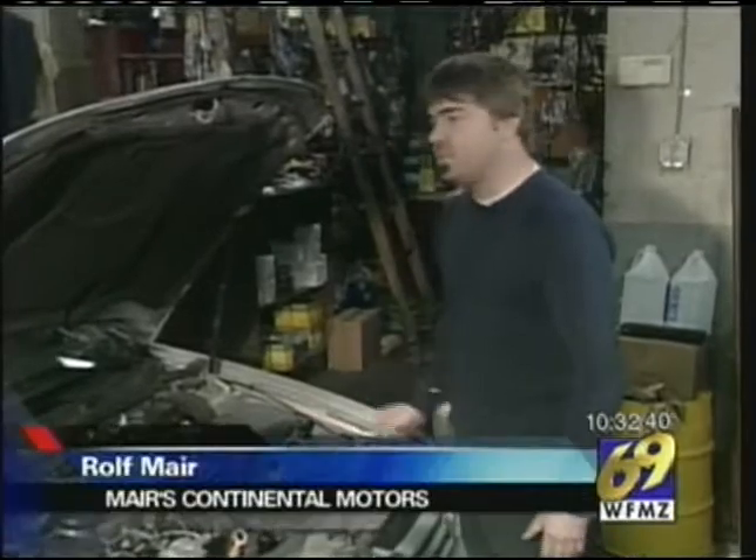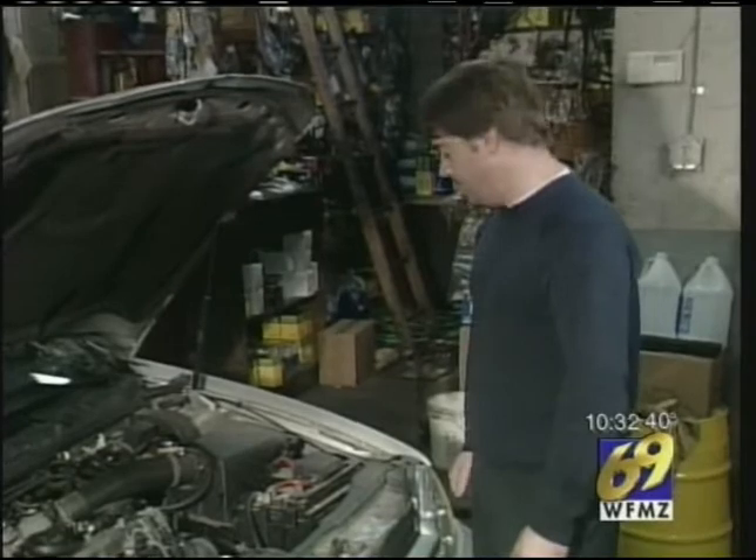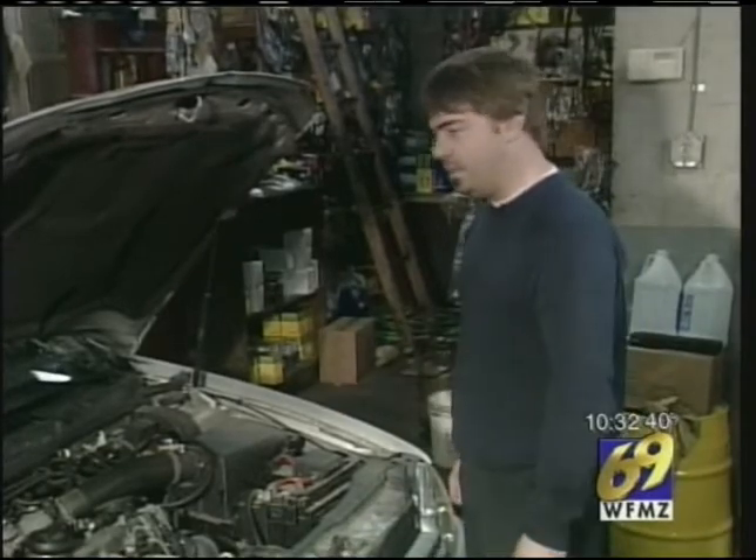If there are, just pour a little bit of baking soda on, spray a little bit of water on, let it sit for a few minutes, and then if you can, hose it off. That'll help eat away some of the corrosion and make the connection better.